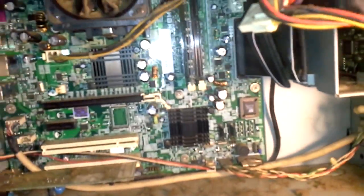There's a blue pin connector right above where it says 'Clear CMOS.' You can take it out and move it to cover the pin that was not covered in the first place — the one in the middle. Leave it on there for about 15 minutes. Do not power on your PC because you will fry your motherboard. After 15 minutes, take it off and put it back exactly where you got it from. Just make sure it's on there snug, then boot your PC up. It'll go through a setup which is really easy.